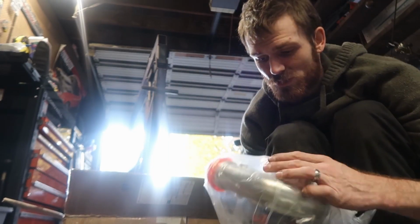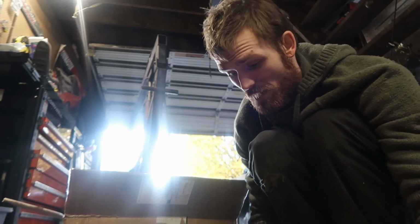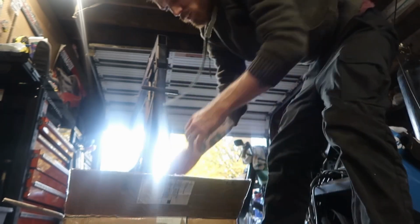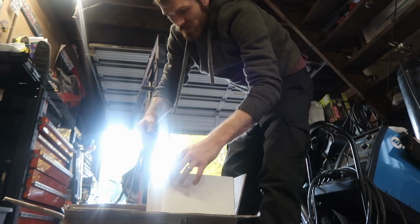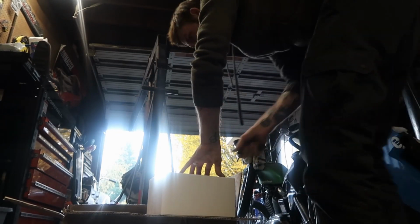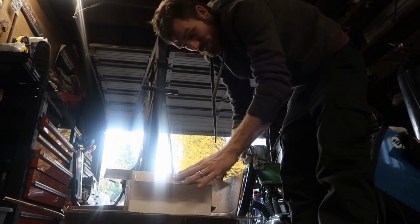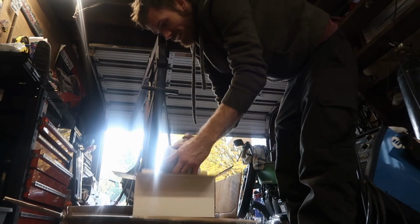Yeah, they're little T3 flange, 3-inch V-band. I'm stoked. I could not be more happy. They're water-cooled also. I won't be water-cooling them at all. There's no benefit to me there. If it was a road race car or something like that where it would see prolonged extended boost, you know, half mile race or something like that, yes. Yeah, little quarter mile S10, not a chance.